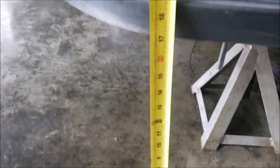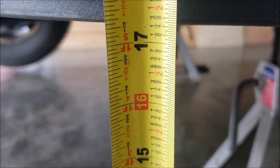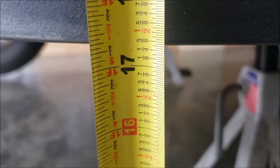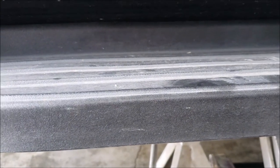So that's the bar I used. As far as how high I lifted it — on a perfectly level surface, measuring to the rocker step, I'm a little more than 17 and a quarter inches. So I'd say if you jack up to where you're at 17 and a quarter inches and you've got a pry bar like the one I showed, you should be good to go.